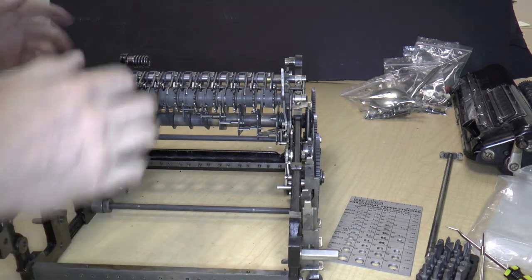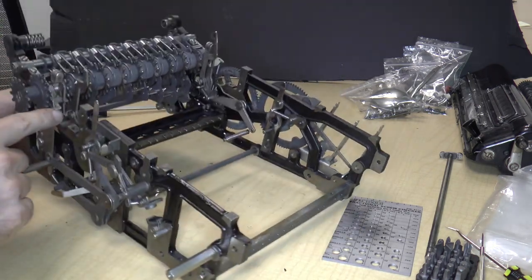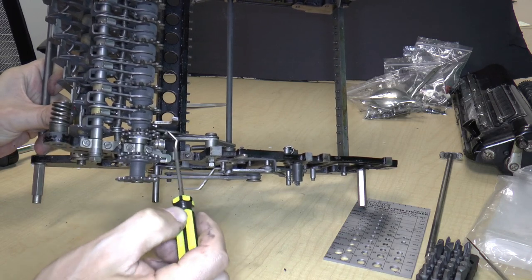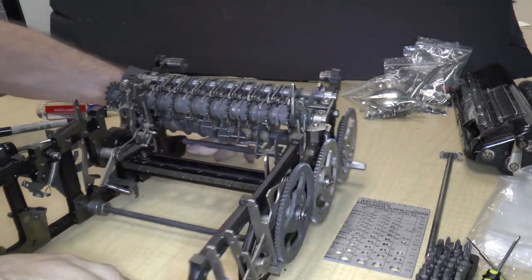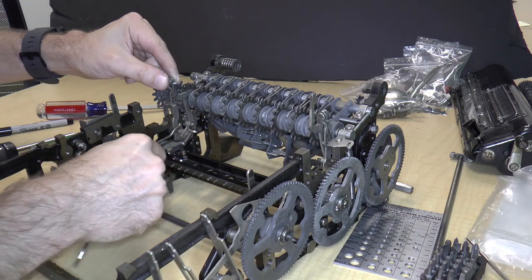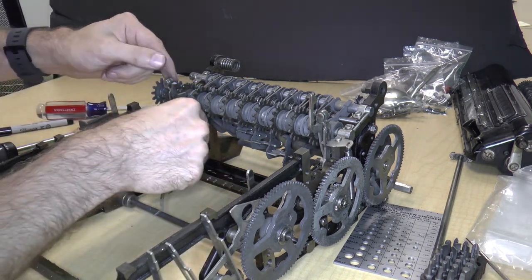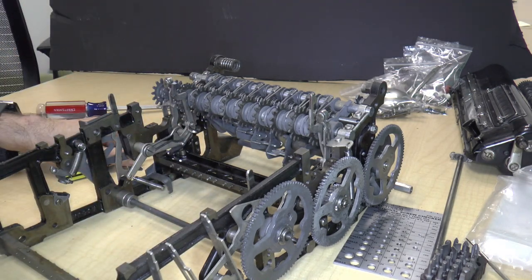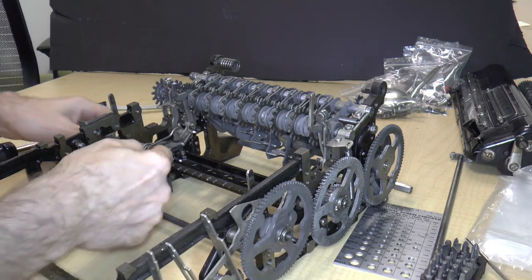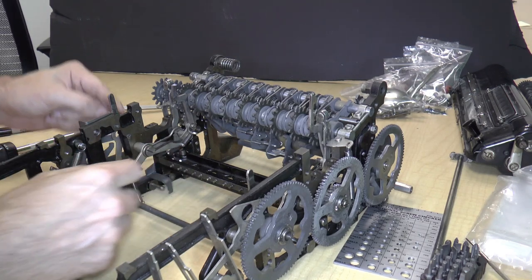The thing is, I was going to take this out, and the reason that I couldn't was that I could get to every screw except for this screw right in here, because this roller is in the way. So I need to remove that somehow. My thinking was this roller is connected to this entire assembly right over here. So if I can loosen this, I can tilt this backwards like this so that I can get at the screw. There is a spring holding that, which apparently I just loosened, so that's all right.